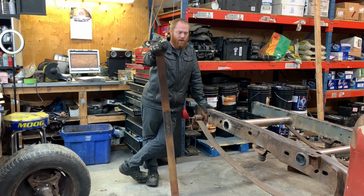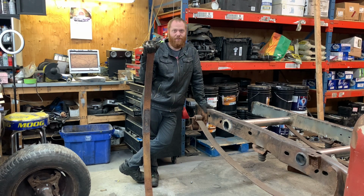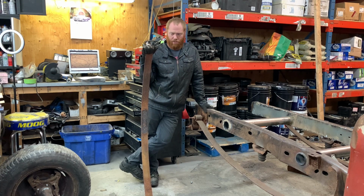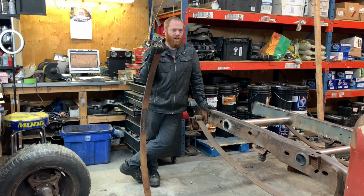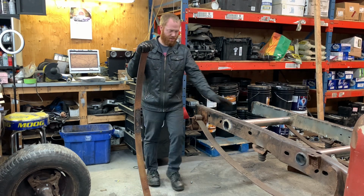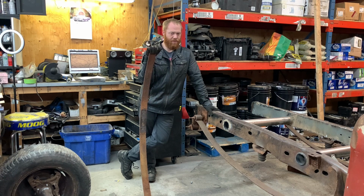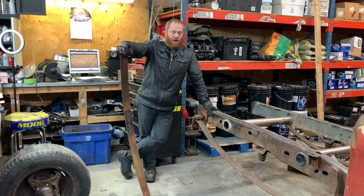If the truck is too high, I was talking to Charles Williams, another guy who saved my behind a handful of times at this, and he suggested that I flip the axle, which I will do. I've got no issue with that, I've done it before, not a big deal, but I don't want to have to notch this frame. He said his might be an 02 GMC single cab, and he flipped his axle, didn't touch the frame, just cut off the bump stops. And he said it only hits on really, really deep bumps. My truck is quite a bit lighter than his. His is probably 4,000 pounds. So it might be fine.